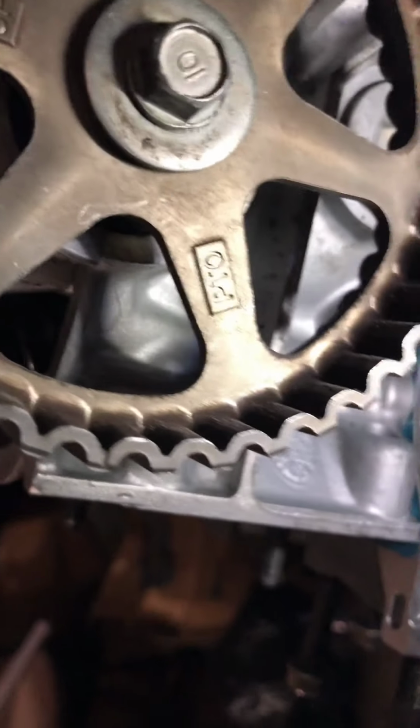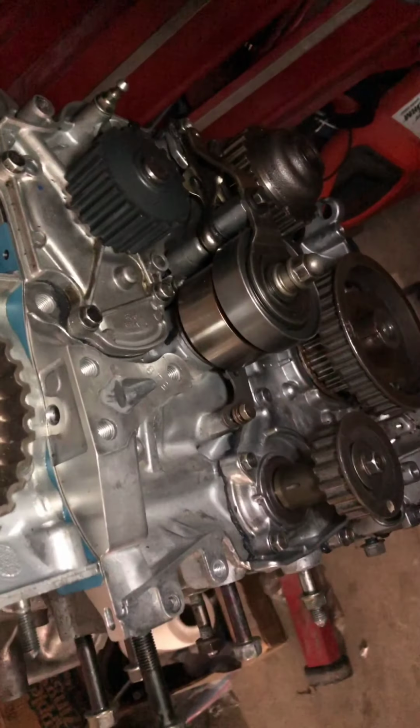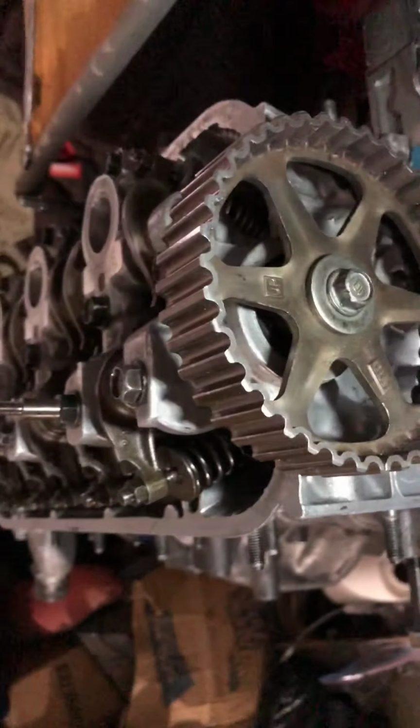Now, over here, I got my camshaft all lined up. As you can see, I got the mark. So, got the mark right there. Got the mark over here. It's lined up with the head. All the marks down there are lined up. I am ready to start putting my belts on. So in the next video, that's where I'll complete that.